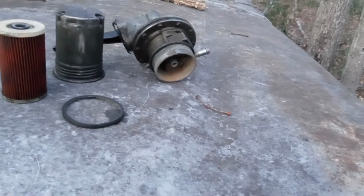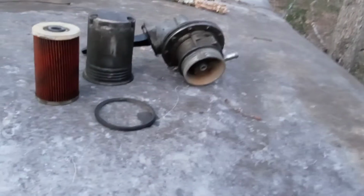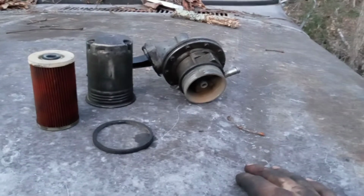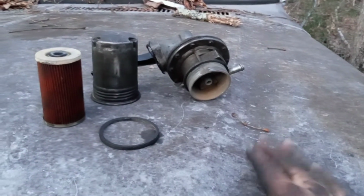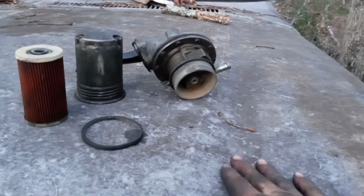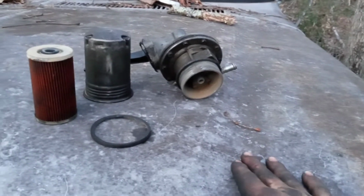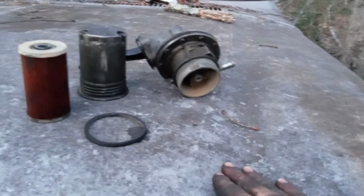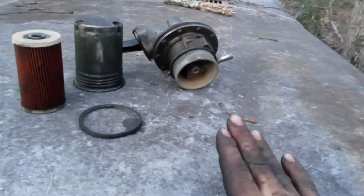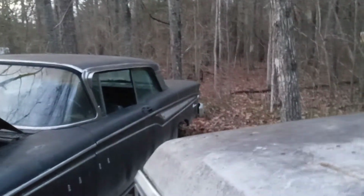And it's not a bunch of crazy ideas where you've got to buy a 64 Galaxie tank and then, quote unquote, retrofit it and all this crazy stuff. The way I've done it to overcome it, and I'll make a video series on it, is we use a '59 Chevy. It could be Impala, Bel Air, Biscayne, whatever. We use that style tank and those style straps, and we retrofit that underneath the car.